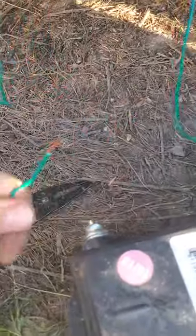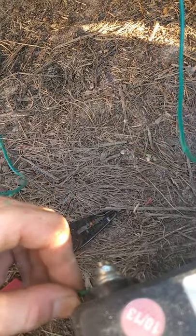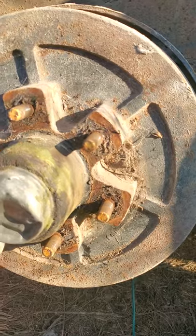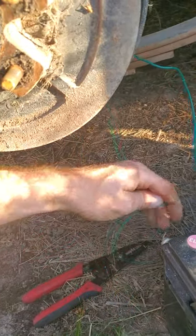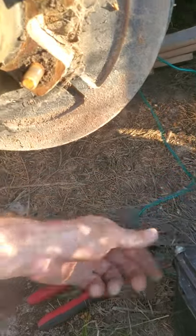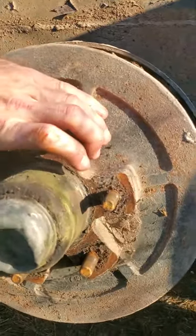I don't want to do this for a prolonged period of time because this is very high amperage to be running through these, but it'll be okay temporarily just to test it. We're going to place that there and you can see that hub is indeed engaged — that brake is engaged. It may not be the greatest; it could be my connection, the battery's weak, or the shoes are worn out. I've never inspected the shoes on this, but you can hear it clicking — that's the shoe in there catching.